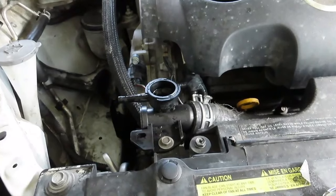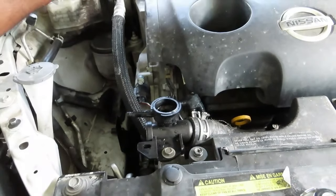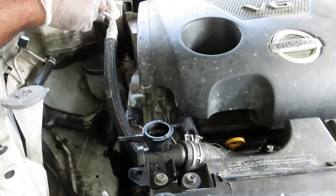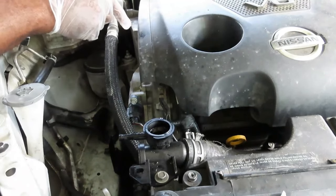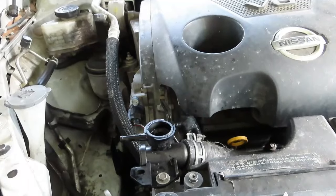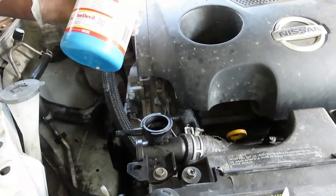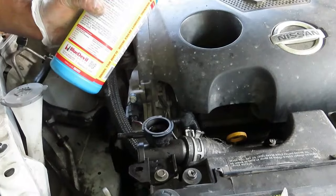Remember, the engine has to be cold. Start your vehicle up and put your heat on high. The reason is you want to make sure the sealer flows through every part of the system, especially your heater core. Remember, I am only going to be using a half a quart — half the bottle — because this is a three-gallon system. If you use more than that, you risk damaging everything. Once we start it up and put the heat on, we're going to come with the bottle and slowly pour it in. Don't pour it all in at once — it should take you about 30 seconds for the half bottle.